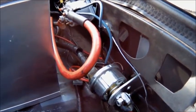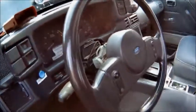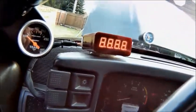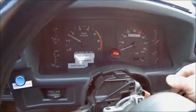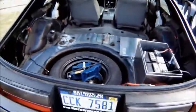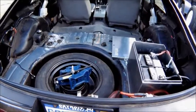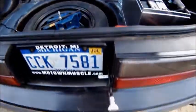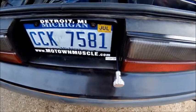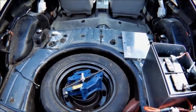Now I'm going to demonstrate how the safety switch works for the NHRA. This is how it's going to have to be. Let me turn the car on — you can see everything's coming up, my gauges are coming on. The car is running. You can hear the car running, everything's fine. Now let's say there's some sort of emergency and I get into an accident, and the racetrack has to kill the power to my car — you just hit the switch and it kills the car. The car is completely dead electrically now. That's pretty much how it works, and that's how you need to have it wired up.